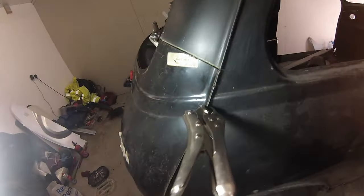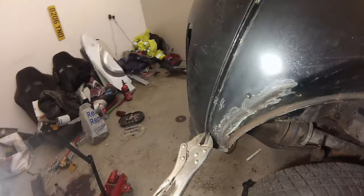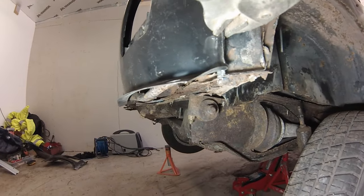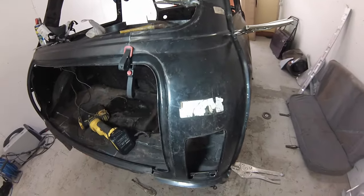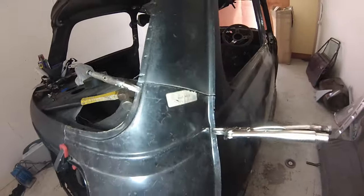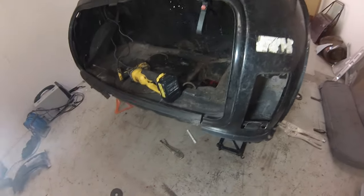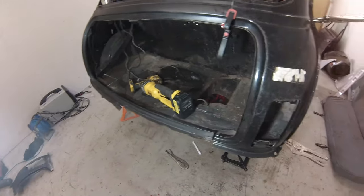There is a bit of give. The line's good down here. There's a bit of a gap this side, so the butt cheek needs to go in a bit. Maybe just more clamp there in the middle and just push and keep doing that way around until I get the right kind of shape. Down here it's pretty good. It does look like it needs to come down maybe a little bit, but it's hard to tell because there's been that much billy barging done in the past. That's kind of success for now — the welding in bit will be the hard bit. I'm going to clean up these bits of metal on the edges on both panels, get these stickers off, and probably mark it in a bit more off camera. When it's all cleaned up, that panel will be ready to weld in. Before I do all that, I'll mark this boot lid on and see how bad that looks.